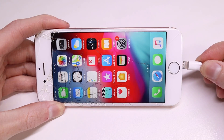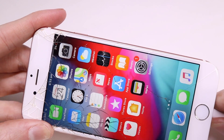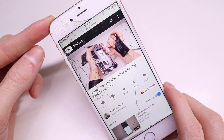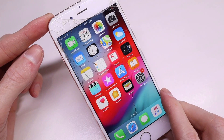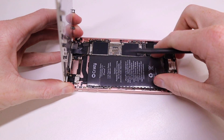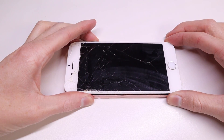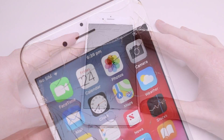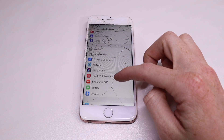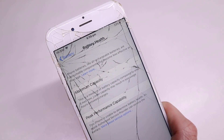When I connected up the charger it jumped all the way to 3%, and then shortly after while watching a couple of YouTube videos to try and drain the battery flat, it actually went up to 19%, which wasn't looking good for this iPhone 7 battery. So I thought I'd test out an official Apple battery to make sure I didn't just have a faulty aftermarket battery. Sure enough, cracking out an iPhone 7 battery that I actually removed from an iPhone 7 that had never been opened, it shared the same issue — going back to 1%. Jumping into Settings and into Battery, you can see that it comes up as 'Service' and that it is unable to determine the health of the battery.